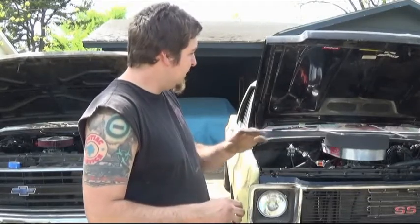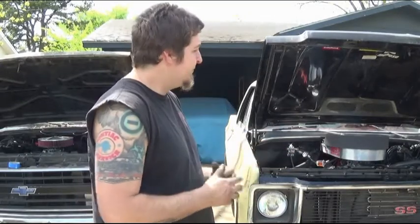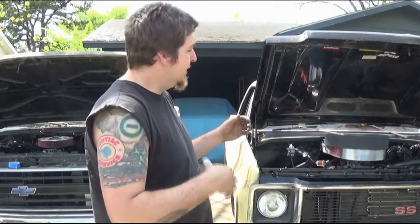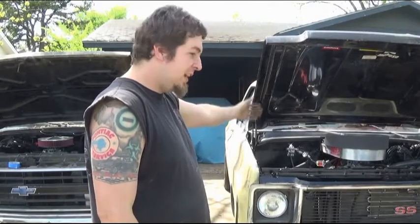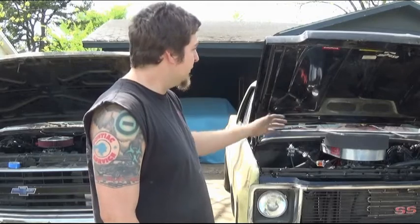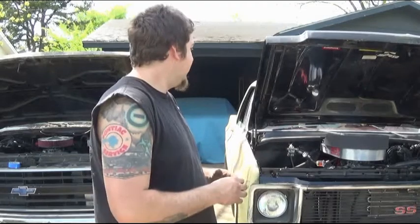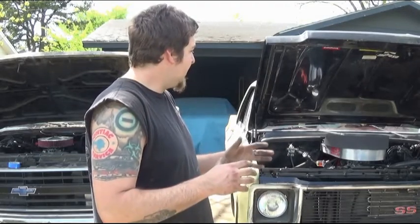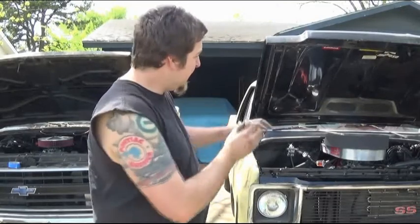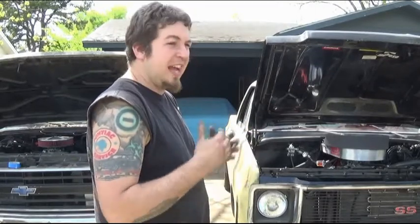Now, when you think about the cool charge coming through, when you're driving around, the cool charge is actually coming through the radiator. Now, I don't know about you, but most of the time, whenever your engine's been running a while, put your hand on the other side of the fan, see if it's blowing or feel it. It's pretty hot. It's not that cool, so it's really not cooling down the intake as much as it really should. Now, also for the simple fact of, you've got to think about a wind tunnel under there. Is it really getting cool air through there around all the obstacles and cooling it off as well? I don't think it really is.